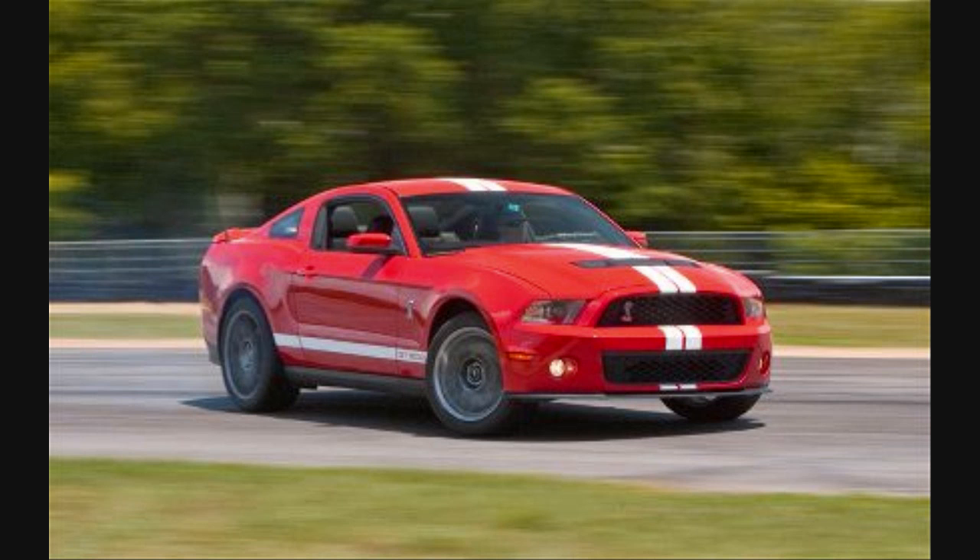So what I needed to do was change that. But to change that, I would have to do something kind of extraordinary because there's really no recommended way to solve the problem. I thought about it and decided that I could remove one of the rear control arms, lengthen it a little bit, and push the tire back.